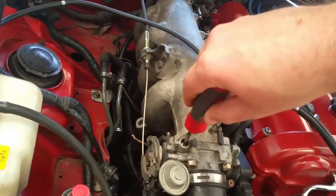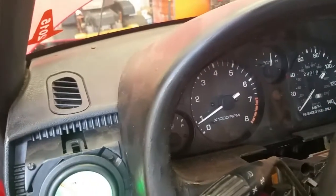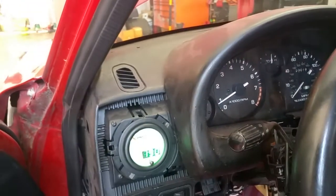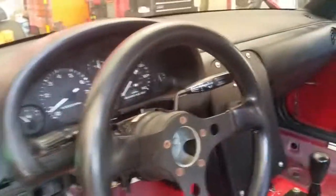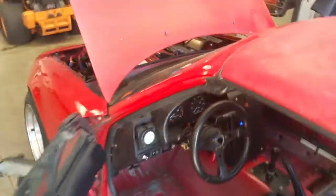Idle's dropping a bit, it's about 950. I'd like it a little lower, so I'll screw it a little bit further in. There it goes — now she's purring. Yeah, that looks pretty good. This RPM gauge isn't exactly accurate so I'll assume that's right. It sounds all right, temps are up. I would say it's successfully timed. We'll see how it feels — see you on the course.